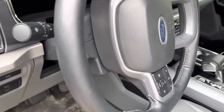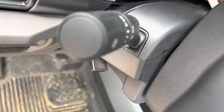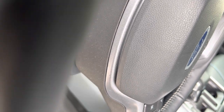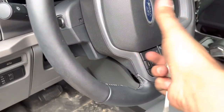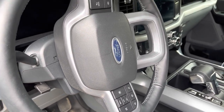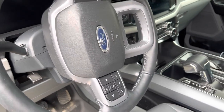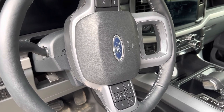We need to turn the steering wheel to the left or right and then behind it there's a slot you can fit a tool into. Wiggle it around — there it goes — and then pull it kind of down, and that's the left side out. Then turn the steering wheel to the other side and this piece will come out. Remember: the 12-volt needs to be disconnected for this. You don't want the airbag going off in your face. If you're just disconnecting the 12-volt now, let it sit for at least 30 minutes to let every bit of static electricity drain.